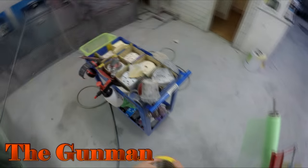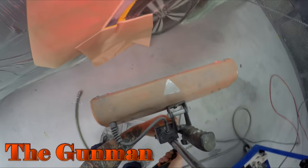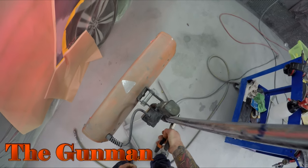What I'm doing here is putting some paper around those areas of the masking. That's mainly because I'm using these heat lights. If you get these heat lights too close to a panel and there's plastic on it you can actually melt that plastic, whereas paper is a better insulator.